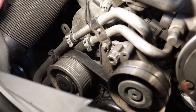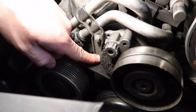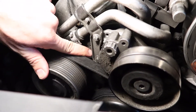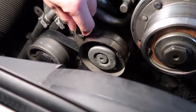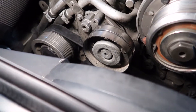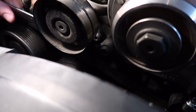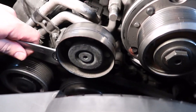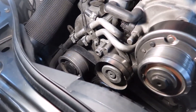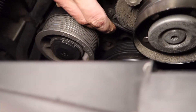So this is the next step here. It looks like there are four screws that have to come out. There's these two right here, which aren't connected to anything — they're just holding this bracket in place. And then there's a screw right here behind the pulley. And to get that out, you're going to have to use your 17 millimeter wrench just like this, and pull the pulley back. You can actually slide a little pin in this little groove right here, which is going to go all the way through and lock it in place, so you can reach the one that's right back there. Because if not, this pulley will be right in the way and you'll never get to it. And then there's one more, located right behind the belt.